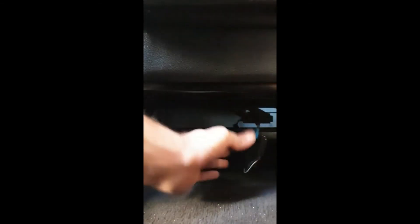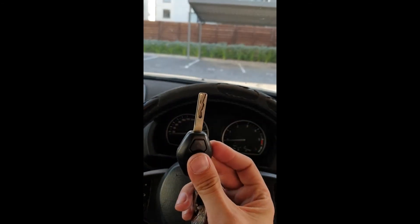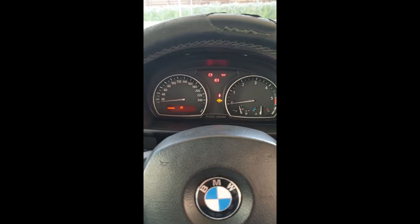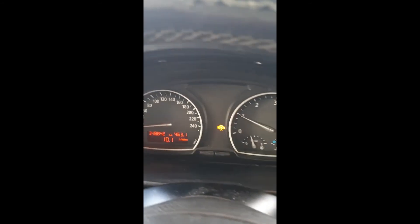Let's plug this in. No need to disconnect your battery or worry about airbags deploying — just make sure your key is removed and there's no power. All we're going to do is put power to the vehicle, turn off the parking sensors, close the door, drop the handbrake.